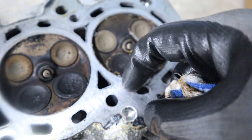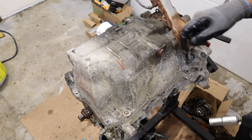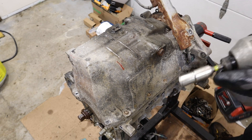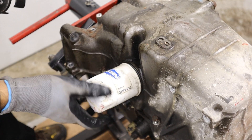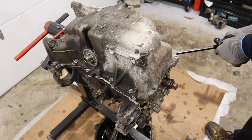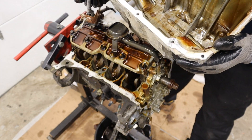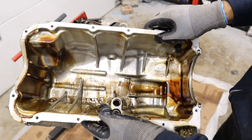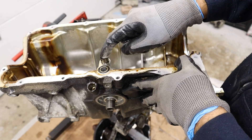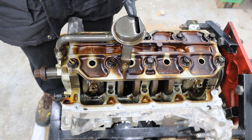At least the oil quality inside looks pretty clean. If you're going to be starting an engine that's been sitting for a while, you might want to soak it with a solution to clean off some of this crust. Now I'm going to remove this oil pan — in typical Honda fashion it's a cast aluminum piece. Popping it off, wow, it looks pretty clean. For a high mileage engine it looks really good, only a few crumbs inside. Here you can see the inlet and outlet for the oil filter, which is actually located on the pan itself as opposed to the block. Next I'm removing the oil pickup tube.